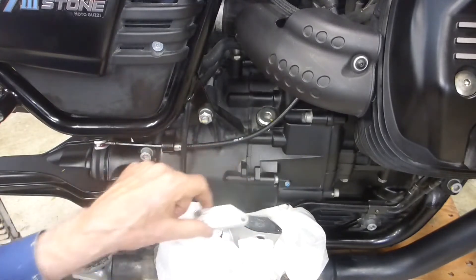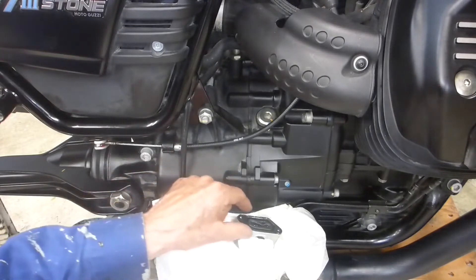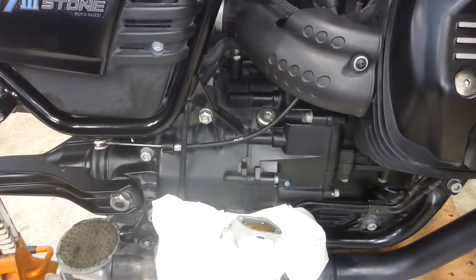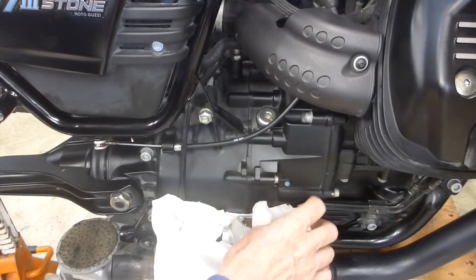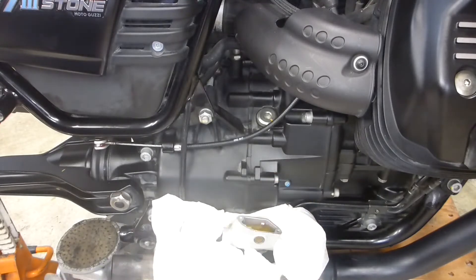I can't think of a faster way to ruin the system. Lift off this little plastic piece and put it on a rag. You can see there's moisture in the reservoir — I understand it sometimes collects water. I'm going to empty that out and put it on my absolutely clean rag. My reservoir is completely full after pushing those pistons back in, a lot fuller than it actually needs to be. I'll take a little spoon or rag to remove some fluid — let that soak up some of the liquid. Now it's removed quite a bit and I shouldn't have any trouble opening that further. When I get the whole thing back together, I'll make sure I still have enough brake fluid in there.